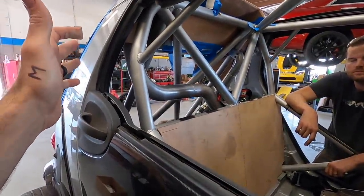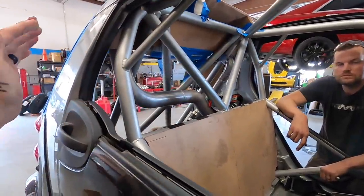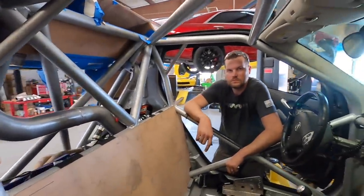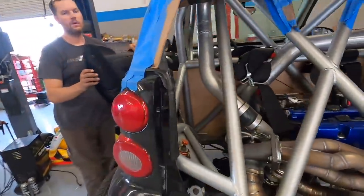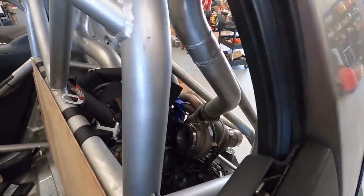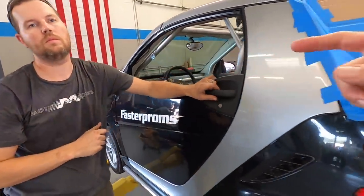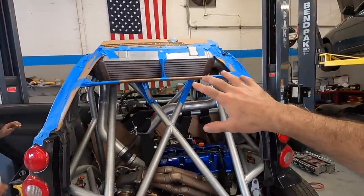We want to scoop air on that side mainly for induction. The turbo really doesn't have any good air so we really want to try and design something going toward where the turbo is. If we have a flat plane going from right here scooping air down into the turbo, that's going to be really good for virtually ambient air — start with cooler air, end with cooler air.